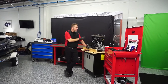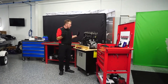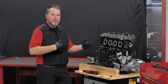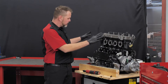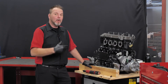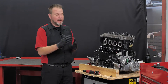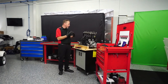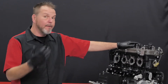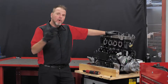You can see right now we do have the engine out. I got it on a makeshift stand that gives me an easier place to work on it than just the ground. I've also removed the intake manifold, the starter, and some other items to keep the weight down. Today we're going to keep diving into tearing this thing all the way down — we want to get the camshafts out, the cam chains, get the cylinder head off, and start looking at the internals. We'll go through some important things about using the coupler tool to rotate the crankshaft and getting everything to top dead center before removing the camshafts.